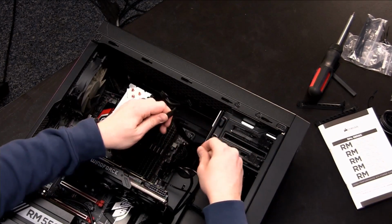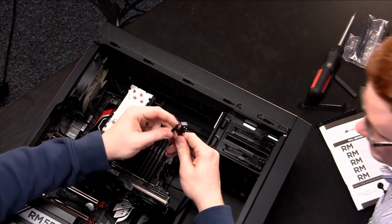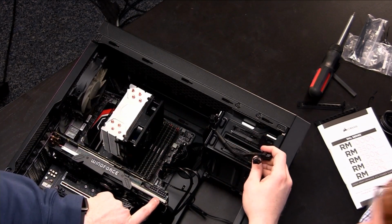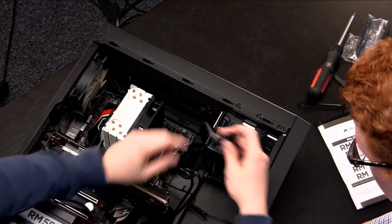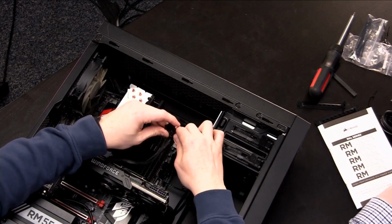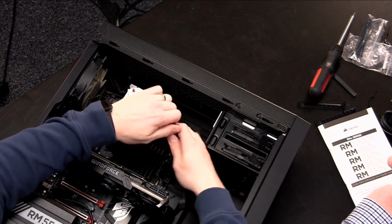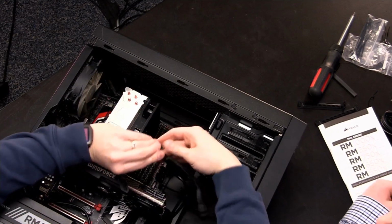Yeah. So now here's something that's interesting. See how this connector has like this extra piece hanging off the side? Right, so how many pins are on that connector? 6. And then 2 makes 8. Look at the video card here. It's got the exact same 8 on both, right? Yeah. So that means that in order for this to work, we have to actually use both pieces of that connector, right? See how you combine those two and it makes an 8? Yeah. 8 pin. So hopefully, if I lift this up, get a little bit more feed in there.